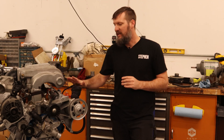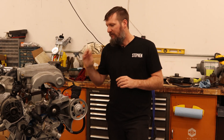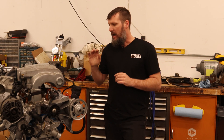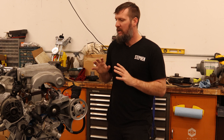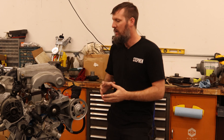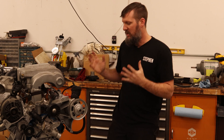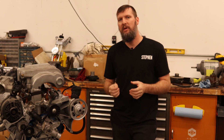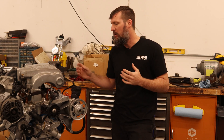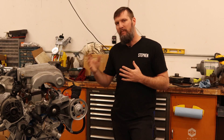I'll try to give as much detail as I can, but this is not going to be a step-by-step how-to. I do have a forum thread going on EFI Dyno Tuning that I will link below, where I'm trying to give a little bit more detail than I can really in the video. But this will be a good way to actually see what I'm doing and see the components. If you're not familiar with distributorless ignition, some of the benefits are better control of spark since you have a coil at each cylinder, less moving parts, and just a cleaner look overall, in my opinion.